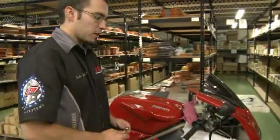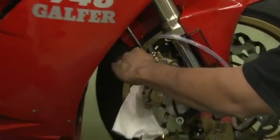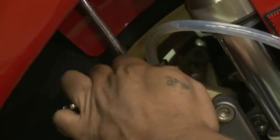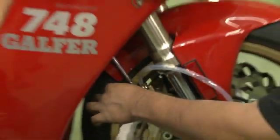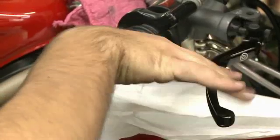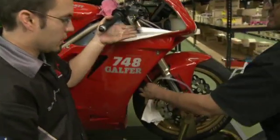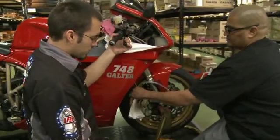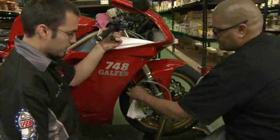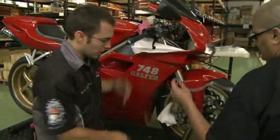From that point we move on to the calipers again, starting at the right side caliper. Build up pressure with the master cylinder by pumping a few times, then hold the pressure on the lever while cracking the bleeder. You can see fluid and bubbles coming out of the caliper. Tighten the bleed nipple, let go of the lever, pump again — you should feel pressure building up through the master cylinder. Repeat the cycle: pump, hold pressure, crack the bleeder, tighten. Do this about three times until no more bubbles appear, then use the MightyVac to suck the fluid out of the hose.